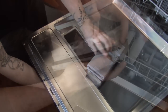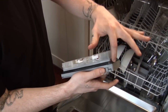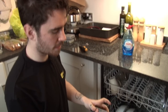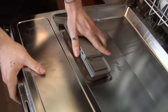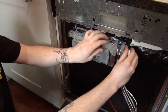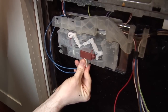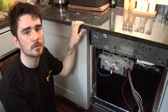There we go. Before you put the new dispenser in, just run some fairy liquid around the seal because it will be a bit tight as it's brand new. Once you're sure the new dispenser is securely in position, just put the connection block back in, and then you just need to put the outer panel back on the dishwasher and you're all done.